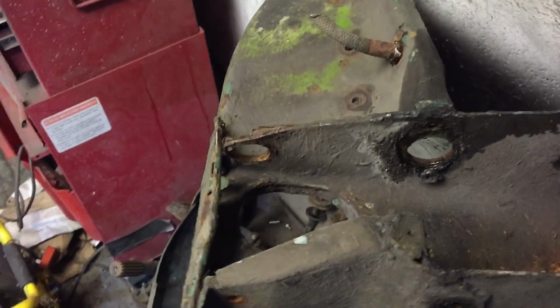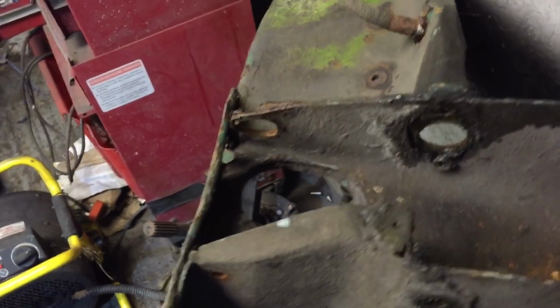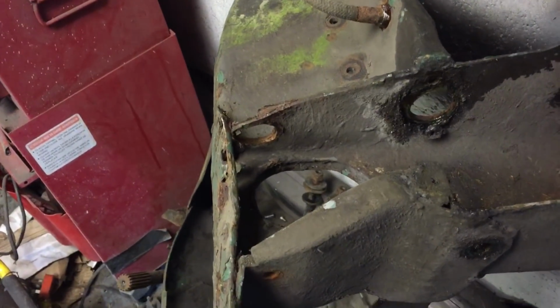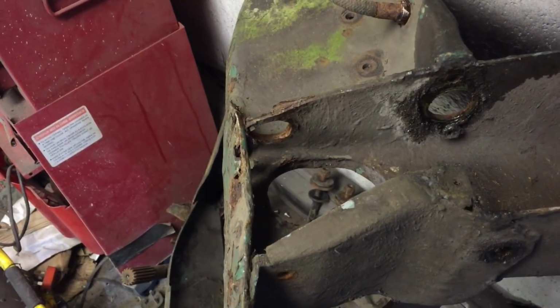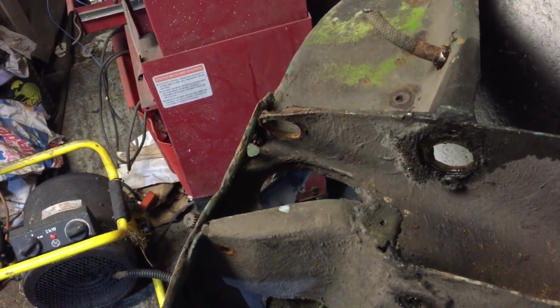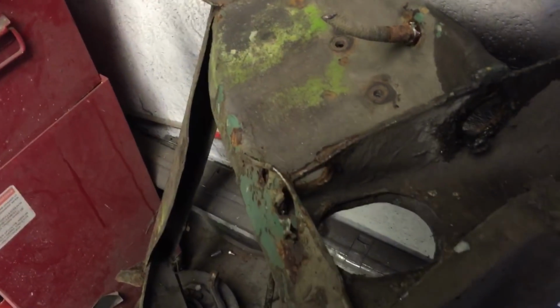So we'll double check the other side. Obviously you need some sort of accuracy on that, because it is supposed to be a round hole, but you can do quite well with a die grinder. Ideally you'd machine it, drill a hole, cone drill maybe, and I could maybe squeeze a reamer through there as well, but we'll see. Obviously it's very bad, this area.